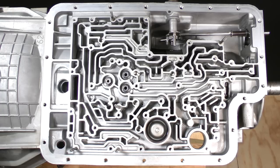Reinstallation of the check balls is next. This year 2000 demo model had 8 balls in these locations. There are actually 4 different check ball configurations depending upon which model you may be working on. This is where the supplemental helpful information sheet, which comes with the Superior kit, really comes in handy. Let's look at it.